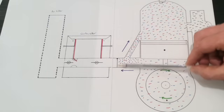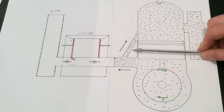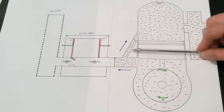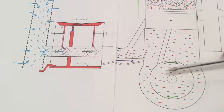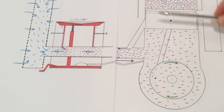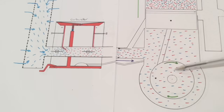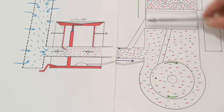Because this piston came down and it's on a crank, and it's still got momentum, it's going to go back up with its own momentum. This special crankshaft — although it's not illustrated here — will have special weights on it that help keep that momentum, to keep the turning of that crankshaft and keep that piston going in between firing.